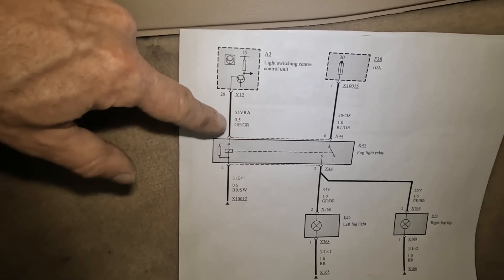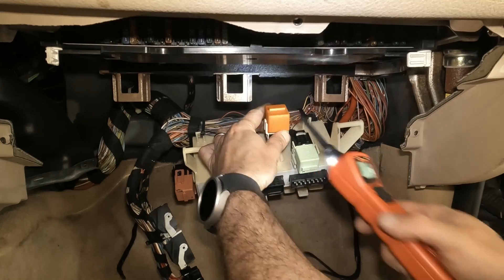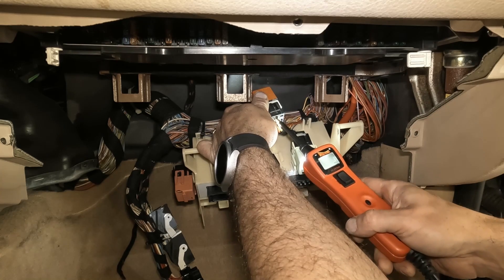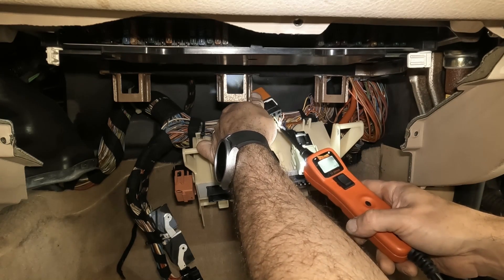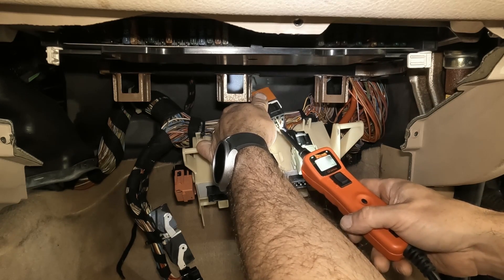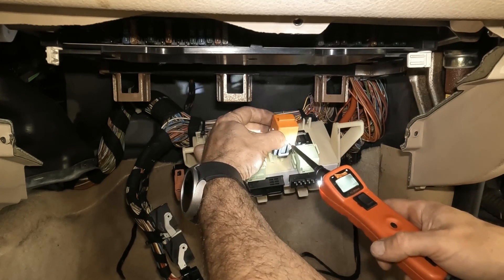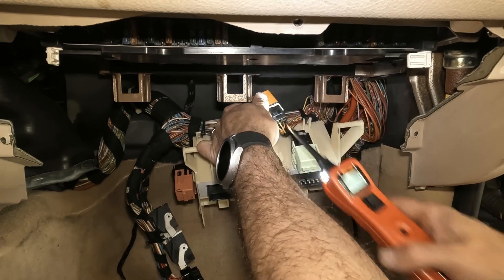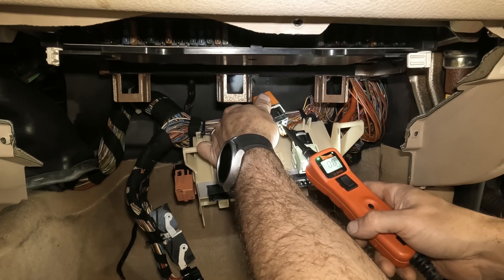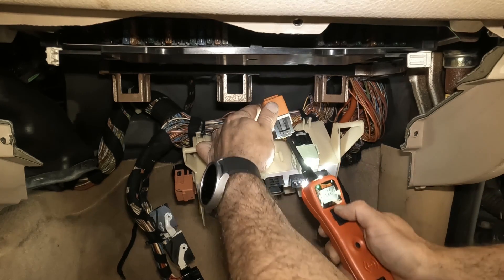You want to check for a short to ground or a short to power. What's awesome is all of these tests can be done with the relay installed. If you flip this over, I can check for power, check for ground, check my voltage side, and check my activation side. Now why do they show as ground? It's because it's grounding through the fog light circuit. This is my activation side — pin 8 — that's where I should be getting voltage when this relay is turned on. So I can turn this relay on by supplying my own power to pin 8 right here, and I can feel the relay click.